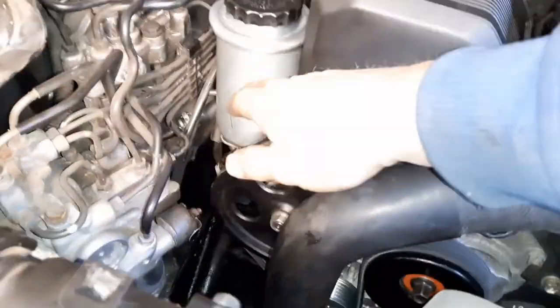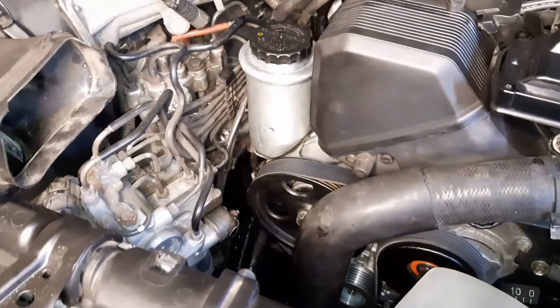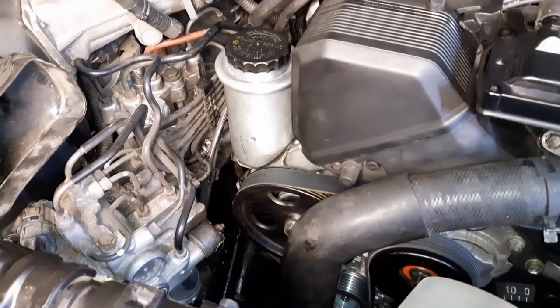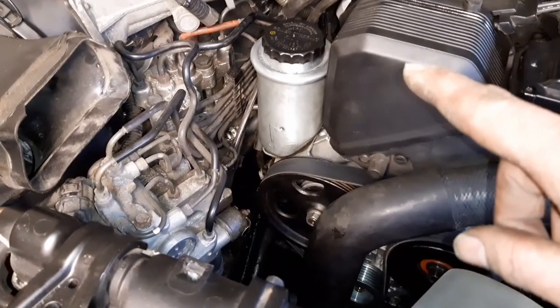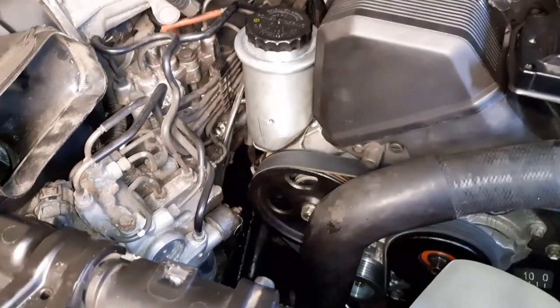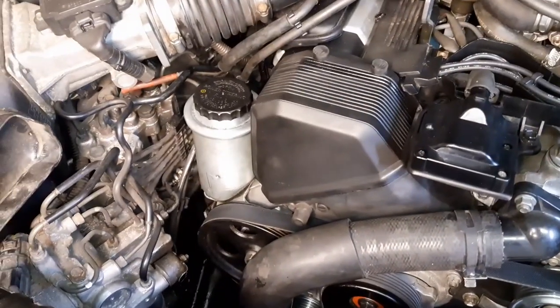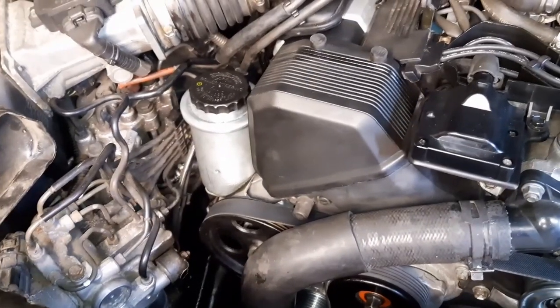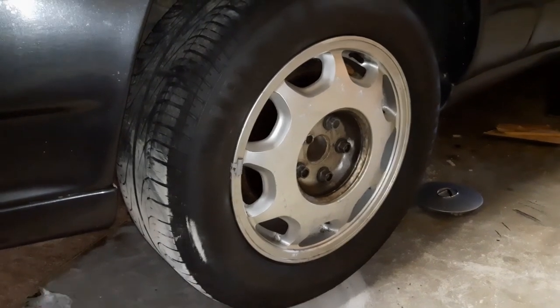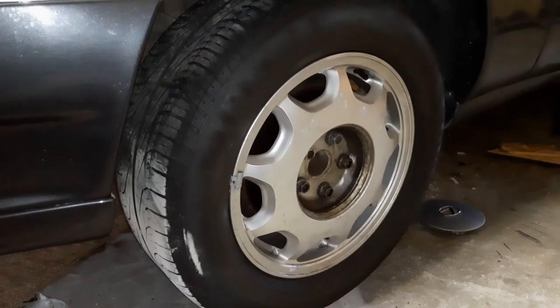I started off by reinstalling the power steering pump. I hadn't been working on the car for a couple of weeks and, as these things go, I lost track of bolts. I found three of the four bolts, so it's currently installed with three. The serpentine belt is back on. I started the car and it still is noisy, but I'll leave that for now. I also put the car up on jack stands so the wheels are free from the floor, making it easier to turn them left to right from full lock to full lock when bleeding the power steering system.